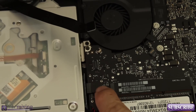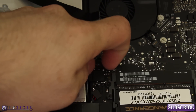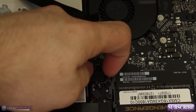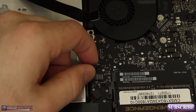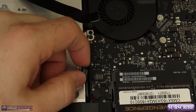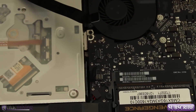The last thing we're going to do is remove the optical drive connector, which is this little guy right here. Same procedure as removing the airport Bluetooth connector — we're just going to pry up a little bit on the sides. Be very careful; these things are fragile. It does appear to be connected with some glue or a sticky pad, so just be careful when pulling that off and make sure that you don't mess up the cable. Now we basically have everything disconnected and can start unscrewing.